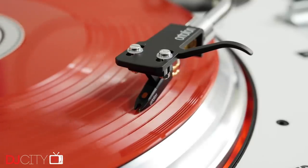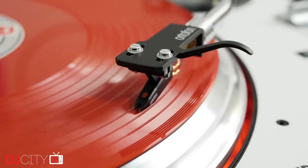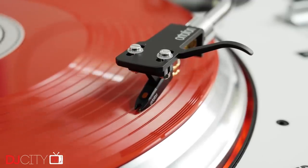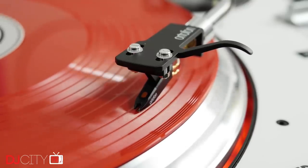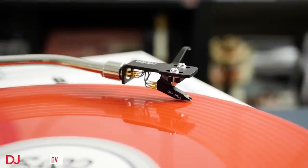At the lower end they have the OM Pro S. When I worked in DJ gear retail nearly 20 years ago, the OM Pro S was the standard cart we'd supply with all the turntables we sold — and for good reason. It's a real all-rounder, offering decent tracking performance and excellent crisp sound quality for the price. It has a recommended tracking force of 4 grams, frequency response of 20Hz to 18kHz, and a street price of around $50 for the cartridge and stylus without a head shell. Output voltage is 5mV — not the loudest, but perfectly good for both DVS and regular vinyl use. I've owned a bunch of Pro S carts over the years and always found them reliable and durable.